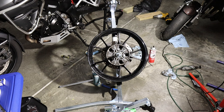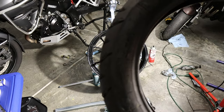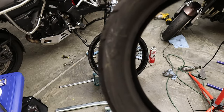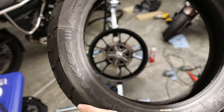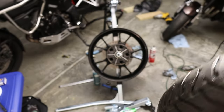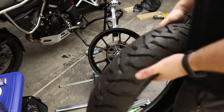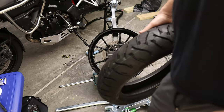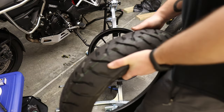The wheel as you look at it would usually be turning counterclockwise, so on the tire there is a 'rear' symbol right there, meaning the tire is going on like that. Whoever mounted this wheel last time had wheel weights on both sides right by the valve stem — I think that's unnecessary, so we won't be replicating that. To put it back on you're going to want to use bead grease.